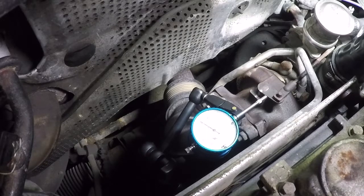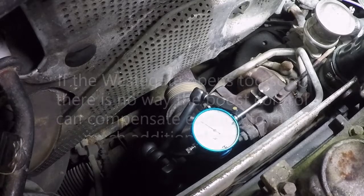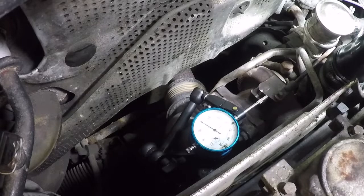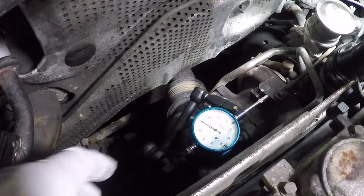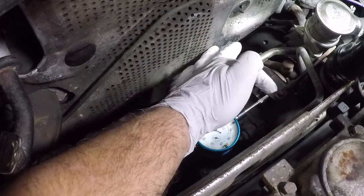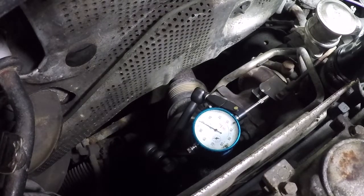Let's just check the last thing. We verified no leaks. We verified the control circuit is new and working fine. So subsequent to that, we've got to take a look at the mechanical side of this business. What I've got is the cover taken off of the wastegate. This little hinge right here, the mechanical arm inside the turbo, is the wastegate.